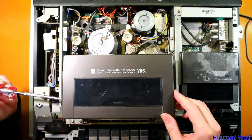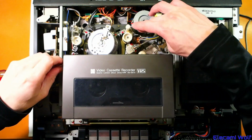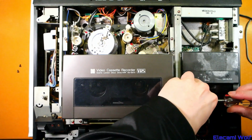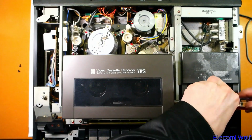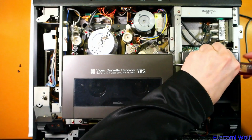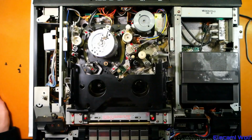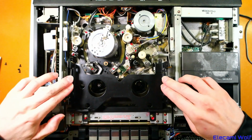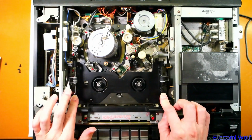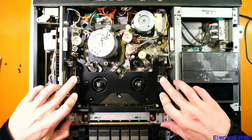Let's probably take this door bit off so that we can look in there properly. That's the capstan flywheel and belt driven. I think this is definitely old enough that it will have a light bulb that lights up the inside of the tape for the end sensors. Oh, maybe it needs that to hold the tape down. So it ejects by those rollers going out.